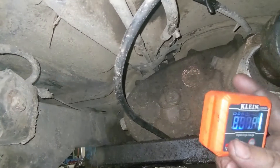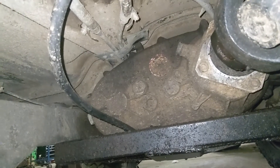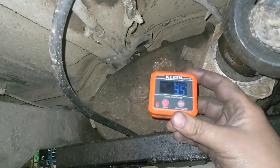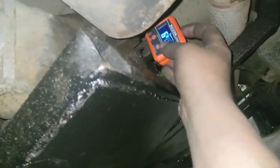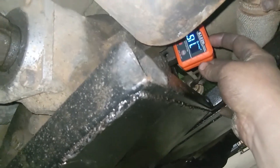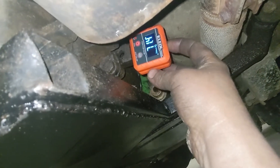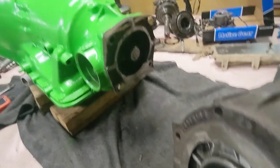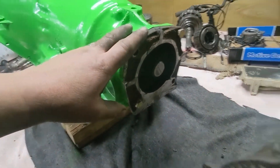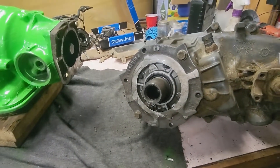So we're underneath the Jeep. We're going to try to figure out the angle of where my transfer case currently sits so I can match it up on the bench. I've got this Klein angle gauge. I'm going to go over here on the side where these lugs are — the magnet's not going to work because it's aluminum. We're getting 71.4 degrees on that lug, so we're going to try to match that on the bench. Both pieces of my adapter are now on their respective chunks — this piece bolted to the transmission and the other chunk bolted to the transfer case. Now we need to marry the two and see if we can replicate the angle of what's in the Jeep.